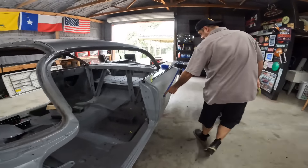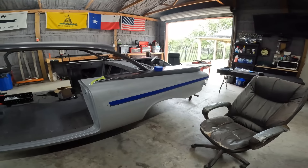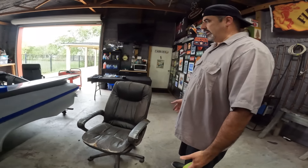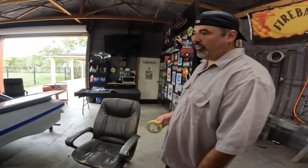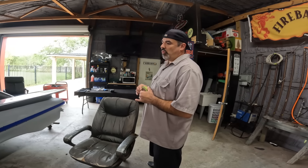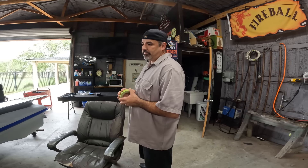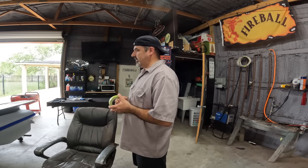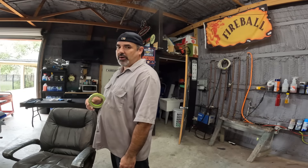What I'm going to do now is run another piece of tape along the bottom, and then I'm going to guide coat the whole thing with the dry guide coat like you saw last weekend. We've got to do the trunk today too. Then we're going to let it sit probably until Thanksgiving, and at that point before paint we're probably going to wash it with gray Scotch-Brite to revive the scratches a little bit before paint. That's the plan — it'll probably take until about lunch. We'll bring you guys back once we get this process started.